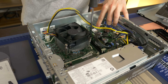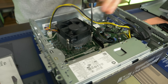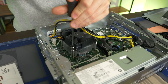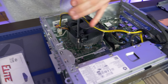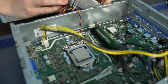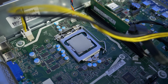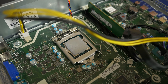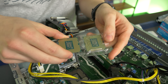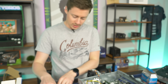This gives you full access to your Wi-Fi M.2 and access to an actual M.2 — which we should have gone with instead of a two and a half inch. It does have an extra SATA port too. We also have a chassis fan header there if you want to add some extra cooling later on. And then I look over and see LGA 1200 — so this is actually an 11th gen socket. That's pretty cool. You could put a 10100 in this technically.